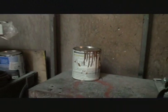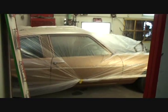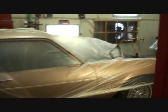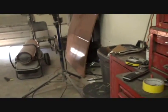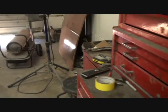If we look right there, that's our base coat paint that goes on this car right here. This car was in a bad collision accident. If you look right here real close, you can see the shadow — it doesn't really have a good shine to it. The reason is this car was painted with acrylic enamel, and acrylic enamel doesn't have a good shine. You can see the hood over there where the light's coming through. It's just got a real dull acrylic enamel look — it's a single stage type of paint that was popular back in its day.